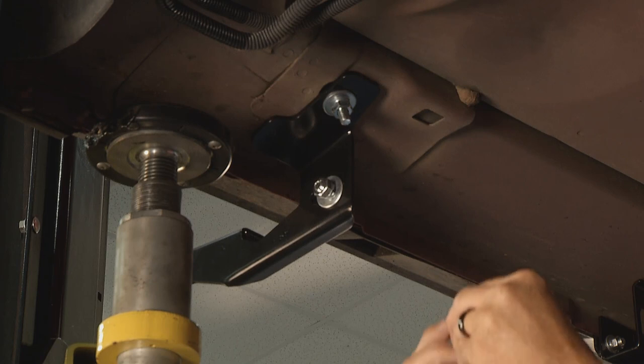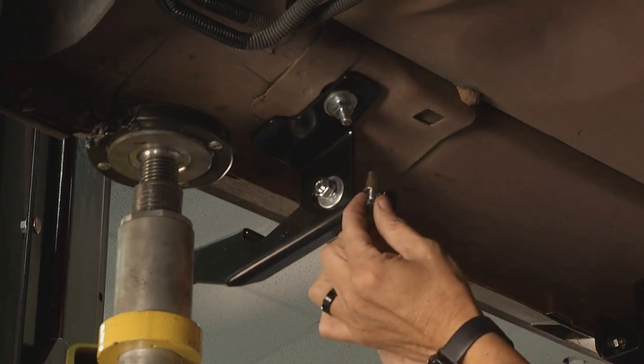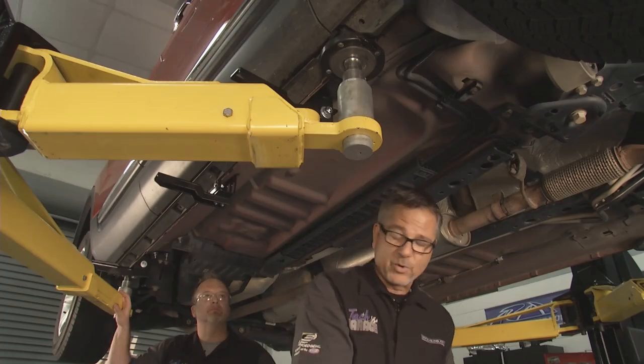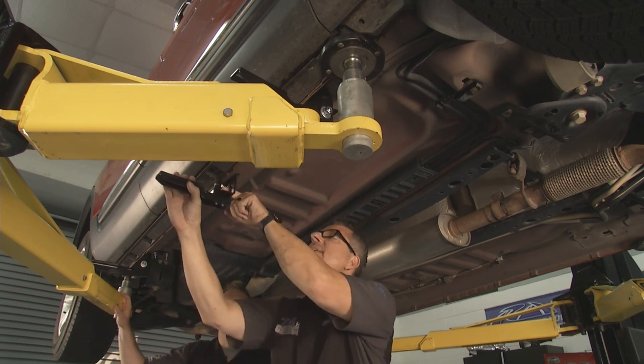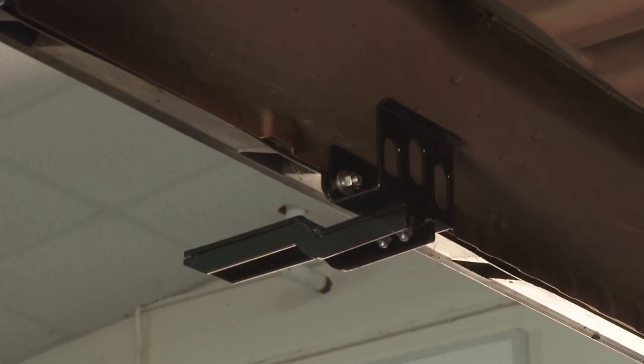But there are going to be a couple places we're going to drill. They give you this little crushed rivet right here — you drill a hole, put it in there, collapse that crushed rivet, and then you can bolt it up. It's dirty right now, but they're giving you that extra support. Come to the middle bracket — same thing. Two clamps right here. In the center, we'll put that same little rivet in there to make sure it's secure, leveraged against the frame.